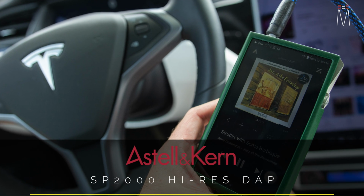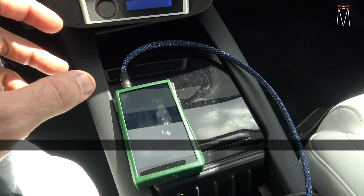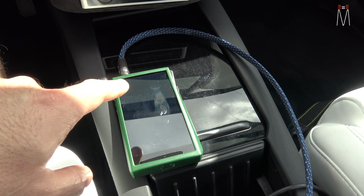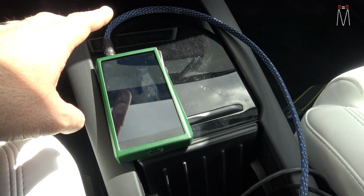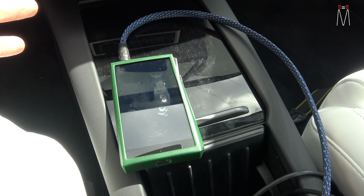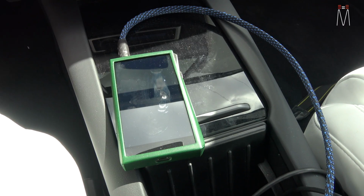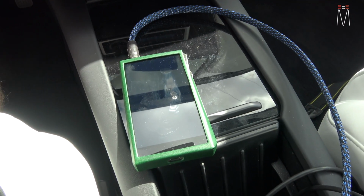So a couple things with that: the processor is going to take a digital coax in of 24/192. That's going to be its processing power. Through Toslink, it's going to be 24/96. So if you had any media on this that's above those sample rates, it's going to be tough for the processor to keep up. It's going to sound like a CD skipping.